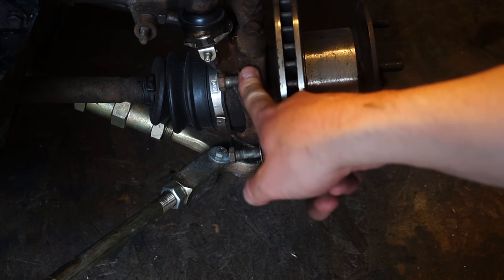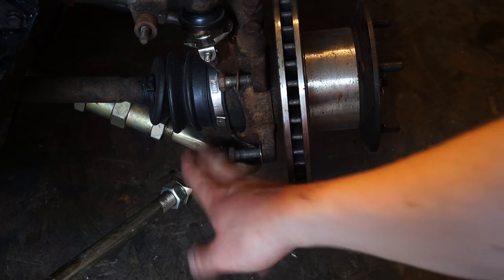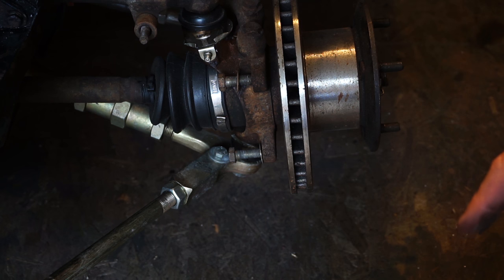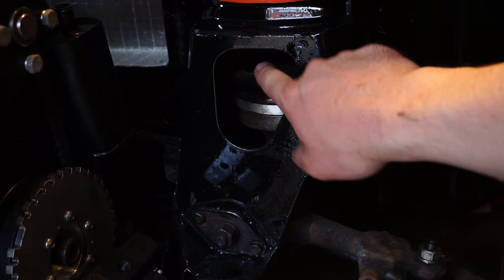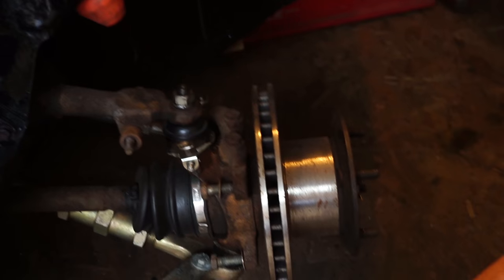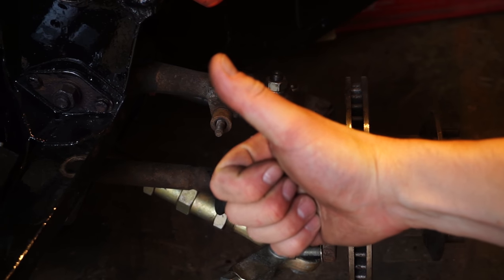Still got to decrust and paint the suspension clearly, but I've got down here the adjustable tie rods and bottom arms so I can adjust my caster and camber. Standard top arm. I've also got springs going in there instead of the doughnuts. Coming along nicely. That's brakes for today — see you next time.